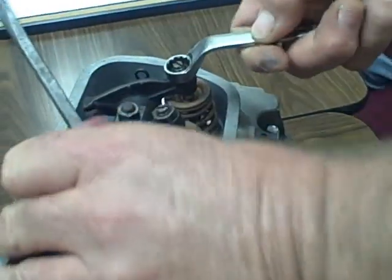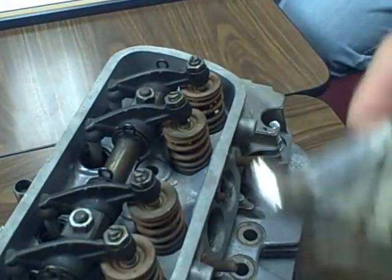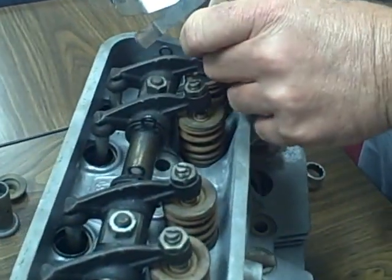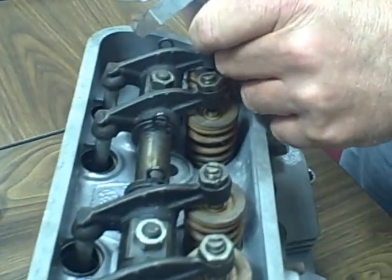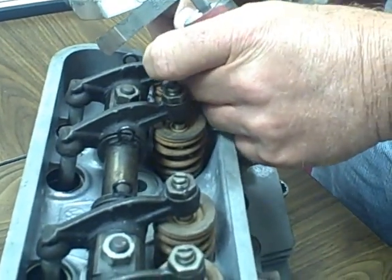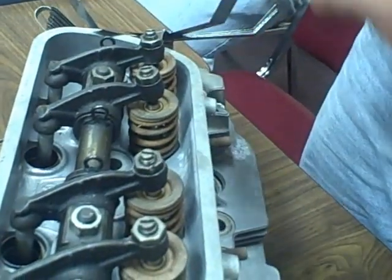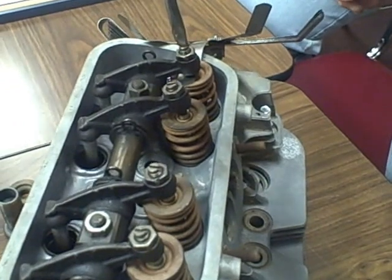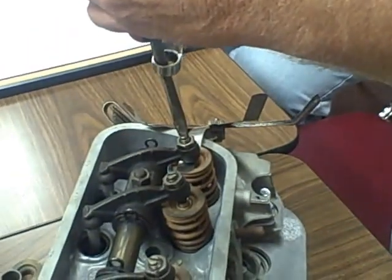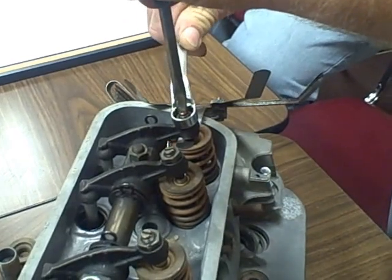The way you adjust it is, you loosen the jam nut. The way I do it — I don't know how David would do it, but I would do it this way. I set my feeler gauge in and run the tappet down to the gauge and feel it just touch it. And I take my jam nut and whip my fingers and turn it so it kind of locks it up. Then you hold the wrench with the screwdriver like this. Just hold it — don't turn it or nothing — and just pull the nut tight.